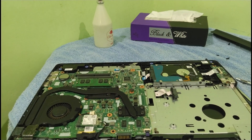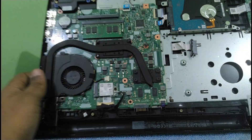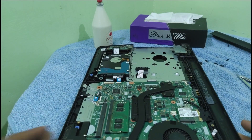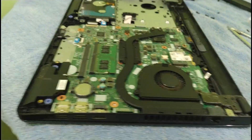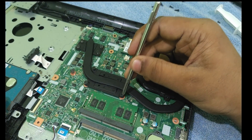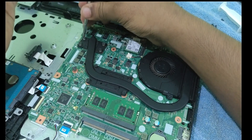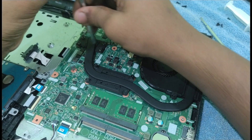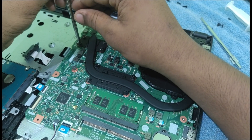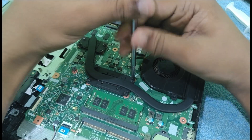As you can see, we are now inside — you can see the motherboard. This is the fan and this is the copper heat sink, which transfers heat from both processors to the cooling fins. The fans blow the heat away from there. When unscrewing the small heat sink panels, go for the opposite ends first to ensure you are applying equal pressure.